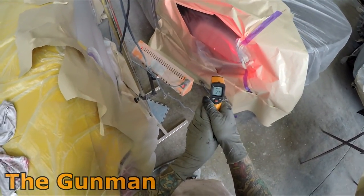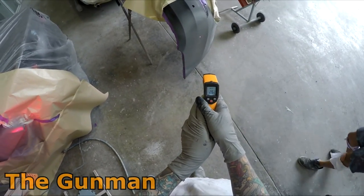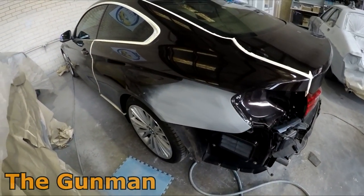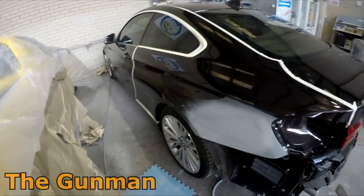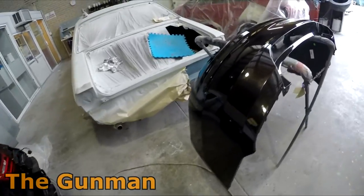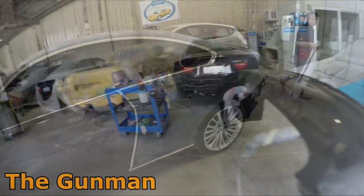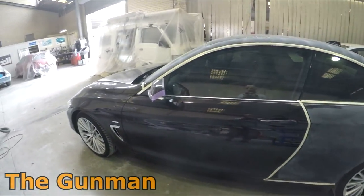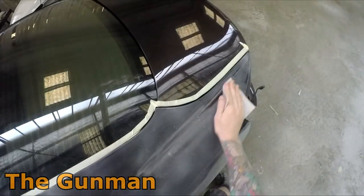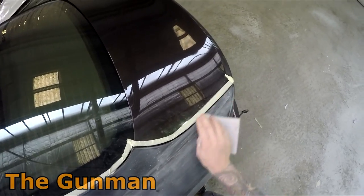As you can see I'm using the heat lights in between coats. It's important to not get your panel or your paint too hot in between coats and also after you've put all your coats on. So that's where that little digital infrared thermometer does come in handy. I picked it up for like $15 off eBay so it's definitely a handy thing to have around the workshop. I like to check my panel temperatures, my paint temperatures — it's just generally handy. You never know when you might need to find out the temperature of something, whether or not your coffee is too cold, and you can give the apprentice a clip over the back of the ears and say mate, I want my coffee to be 65 degrees exactly when I get to work at quarter to eight in the morning.